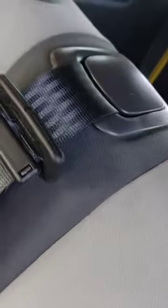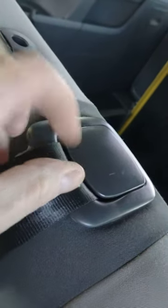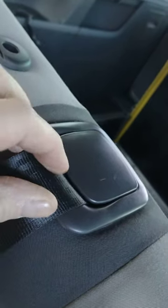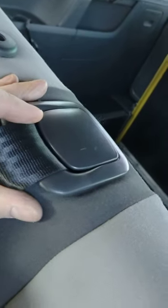I've come across it a couple of times now and I've only just figured out what the problem is. We've had these belts replaced because a dog chewed them, so somebody put some new webbing in. What it is, is there should be a little plastic rivet in the belt that stops it going too far back. It catches on this cover here, and this cover can come loose and go missing as well, and that will cause the same thing. The last one I did had the same problem.